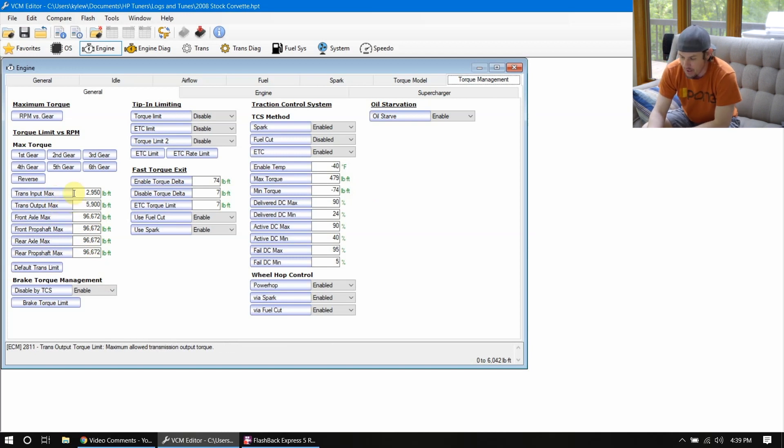As you can see, these max out at 97,000 foot-pounds. The trans input does not max out there, because the transmission technically is a torque multiplier on an automatic transmission. That's why we can only max the trans input out at 6,042, and kind of the same ordeal on the trans output at 6,042. That's not necessarily an accurate representation of the output on the transmission. Maxing these out just goes ahead and does away with one control mode that we have to deal with.